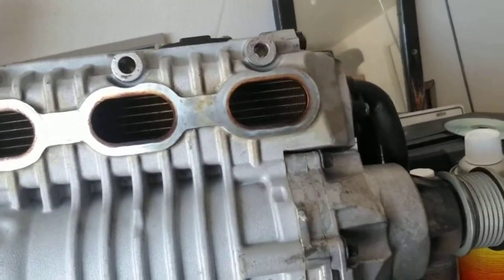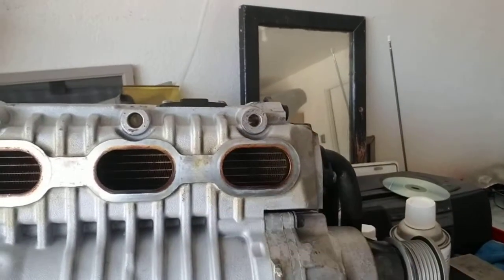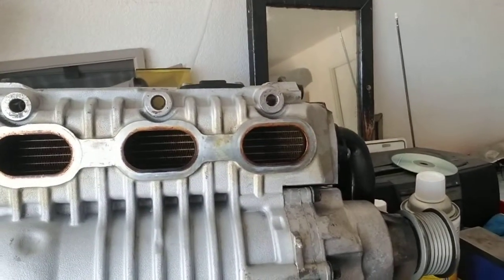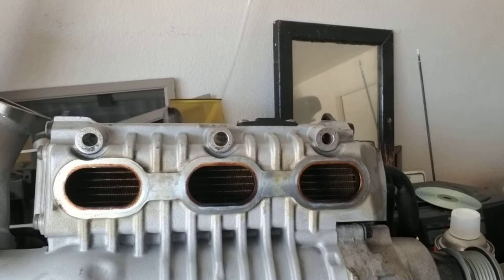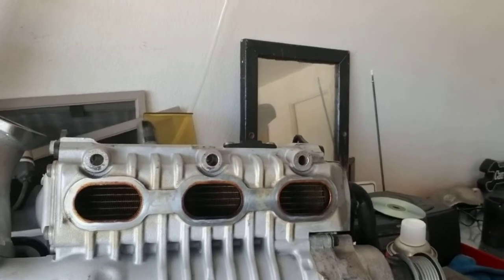Supercharger, not bad for the amount of miles on the car. A little bit of vapor. I'm going to clean that out. This was probably before, actually, you know what? It's definitely before I put the catch can on there. And I figured the PCV had some issues with it anyway. Rough idle, it just felt a little weird, lacking in power, a little sluggish. Some vapor blow by. So I think these things were known to have a bad PCV unit. So clean this up as much as I can, and then I'm going to get to the valves, clean the snot out of those, and this thing should be running like it did when it was brand new.